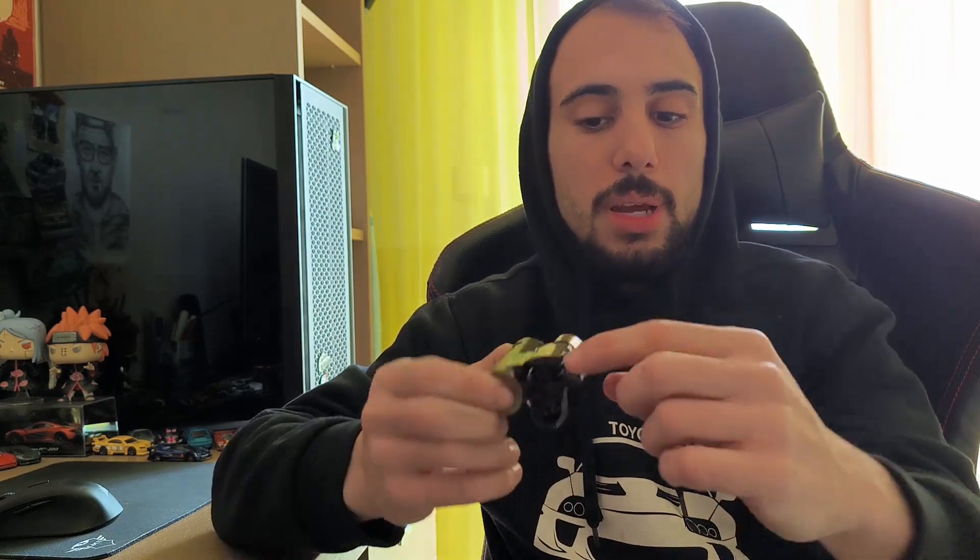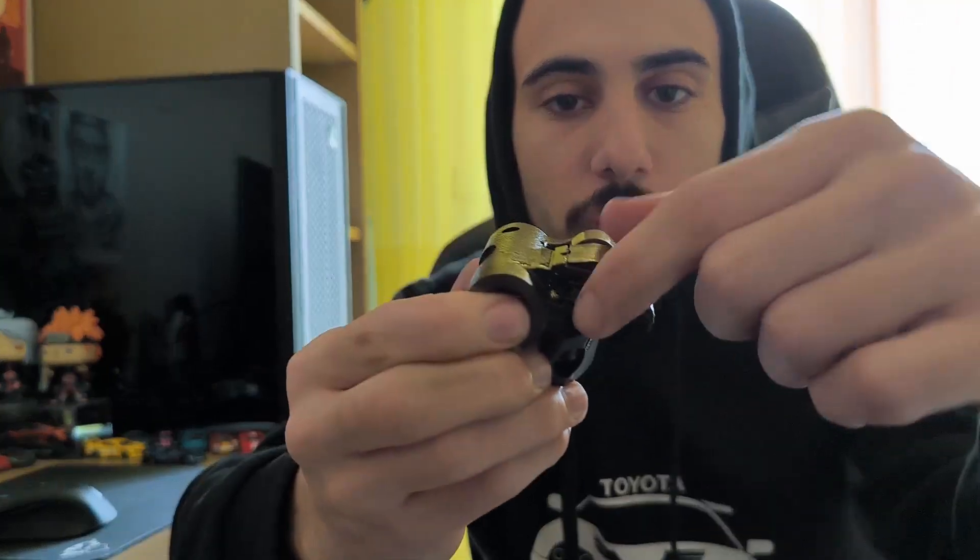I tried to get four of those replacement pads but unfortunately they're discontinued. You would take the spring off, remove the original pad, and get a wider and longer pad for the camshaft to work on. I don't know why Toyota went with that design — nobody ever understood it. These rocker arm pads are the main problem. If you see a wiped cam on cylinder 2, you also need to swap the rocker arm — otherwise you'll wear the new cam again.